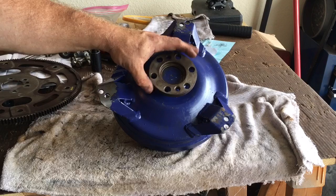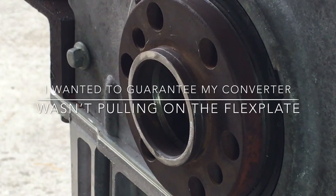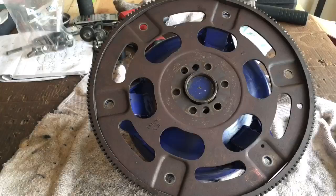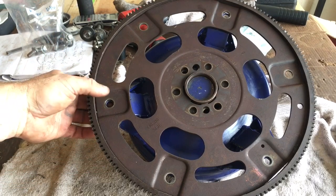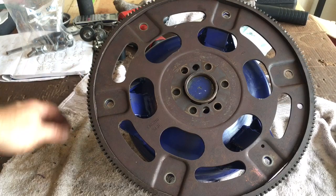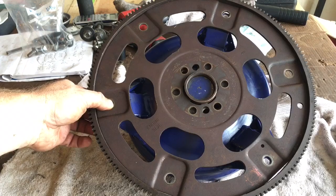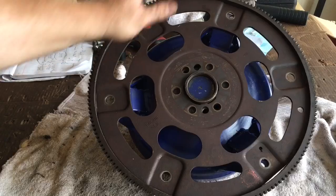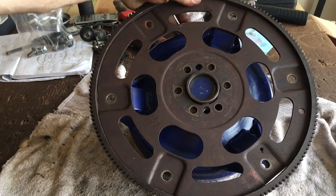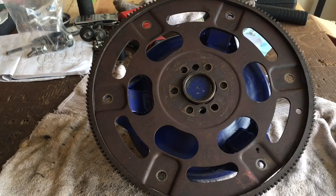The shiny surface on the outer area is where I ran the flapper wheel to remove those 55 thousandths. Normally when putting an old-school standard bolt pattern torque converter on these LS engines, you have oblong holes in your flex plate to match the metric bolt pattern. The dual bolt pattern converter — the wider bolt pattern — will work with the larger second pattern on the converter.